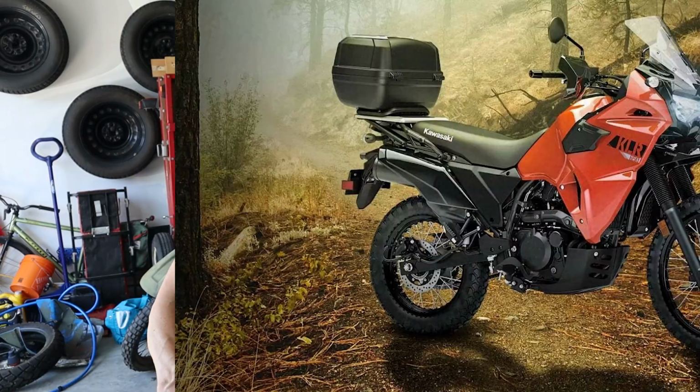There is a 25-cent mod. If you Google that, KLR owners like to do it. It fixes the mid-range lean jetting. These things are jetted lean from the factory. They were able to keep the carburetor up to like 2018 because some Japanese motorcycle grandfather clause allowed them to just keep making carburetors unless they changed the bikes, which they did in 2022, went to fuel injection. But we still have a carburetor on this one.